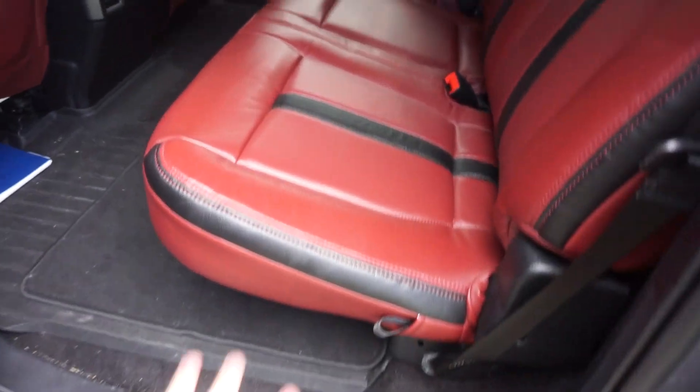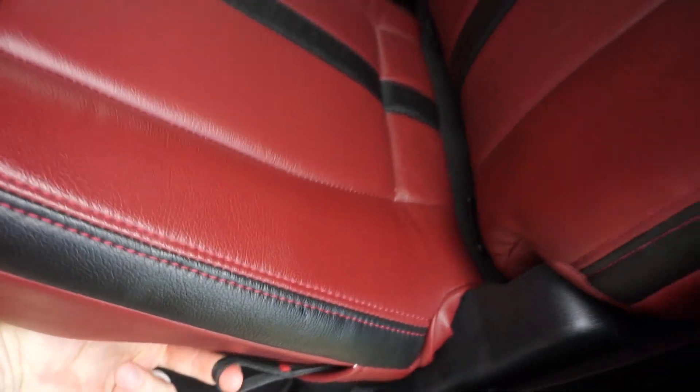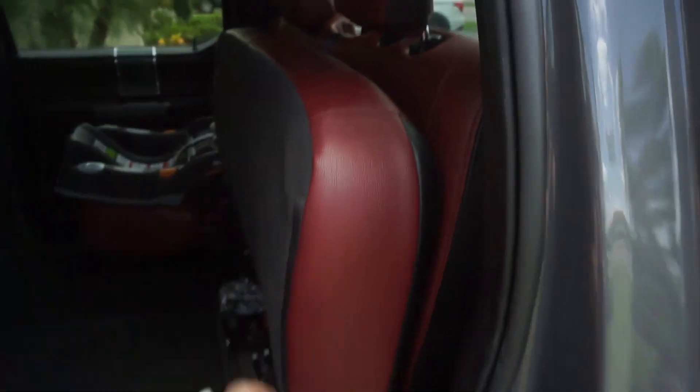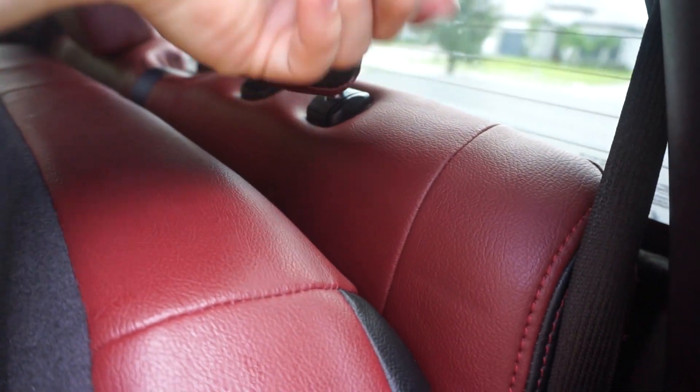Now I'm not gonna skip over the part where I show you how to actually get this seat down to access the storage. Step one: come to the back seat right here, grab on your little strap, pull and lift your seat up at the same time. Doing this brings the seat a little bit forward, which reveals the latch that you need to get your fingers back there and pull up on. There are actually a ton of aftermarket, third-party utility latches sold online for this, but truthfully it's not that hard — I just use my finger, get back there, pull up on it, and the seat naturally falls forward.